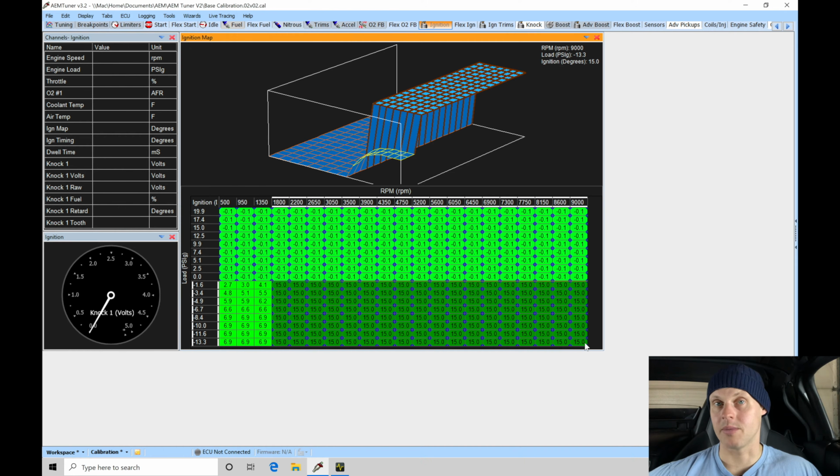We're going to go through the spark timing optimization process in this next video. By having low spark timing, we can focus on our fuel tuning first, then tackle our spark timing, part throttle, and then we can move into our fuel tuning on the wide open throttle area. So we can move into our boosted area here. Having 0 degrees or really low spark timing in the table is going to allow us to focus on the fuel first, then spark timing. So that's always the order of operations. Tackle your fuel first with low spark timing, then bump up your spark timing, get that sorted out.